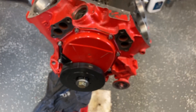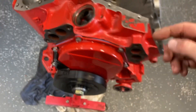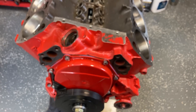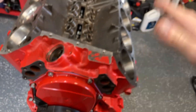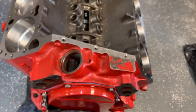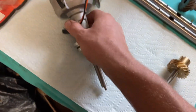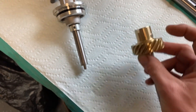The way I discovered this: I had dropped a new distributor into an engine that had just been rebuilt — everything was new, even a new intermediate shaft from Milodon. New Milodon shaft, hydraulic flat tappet cam, and I could rev on the engine. It would rev strong, but when it was coming down off that rev it would just break up like that. So I was scratching my head, and come to find out the distributor that I dropped in — the end of the shaft — was not fully engaging the intermediate shaft that was being used.